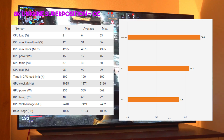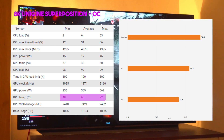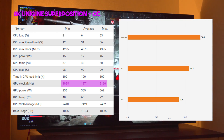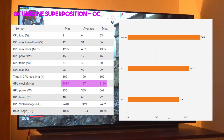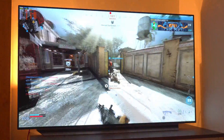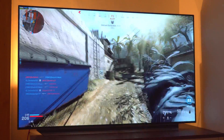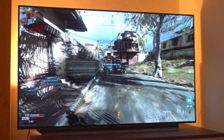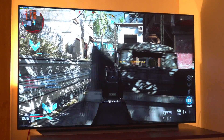On silent mode you'll notice a considerable drop in average temperatures, going down to 65°C from 75°C. As a result, core clocks boosted up to 1974MHz on average, 2160MHz maximum, and 1935MHz minimum. That's a 375MHz increase on the minimum, 195MHz on the maximum, and 177MHz on the average. Frame rates were more consistent, overall higher, and stuttering occurred less frequently — all while being silent under the sound of gameplay.